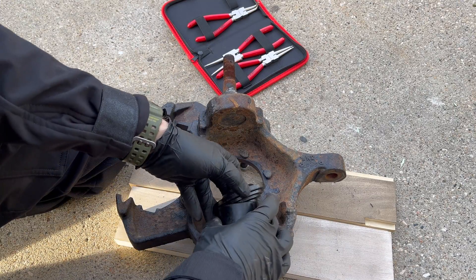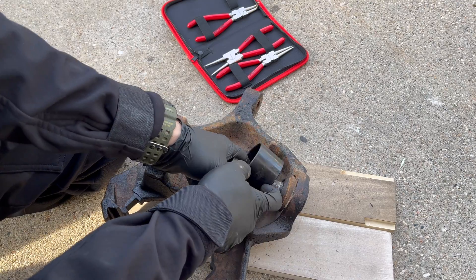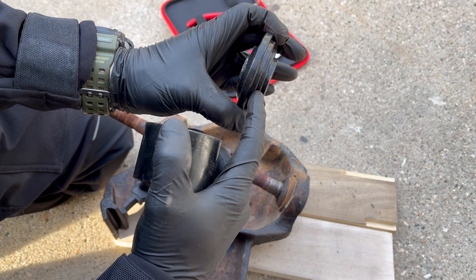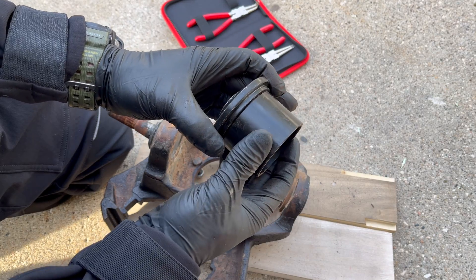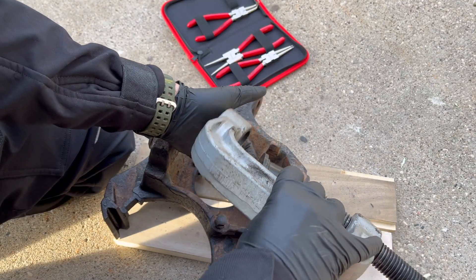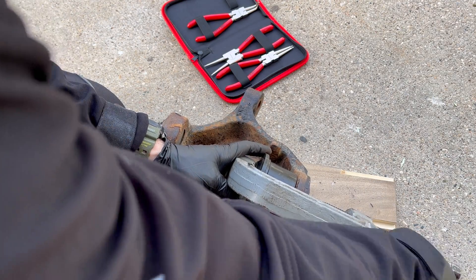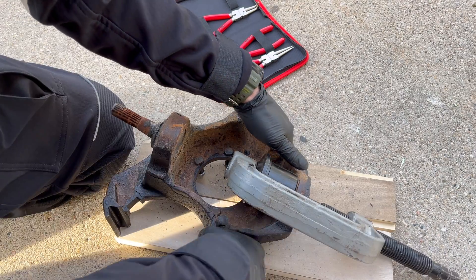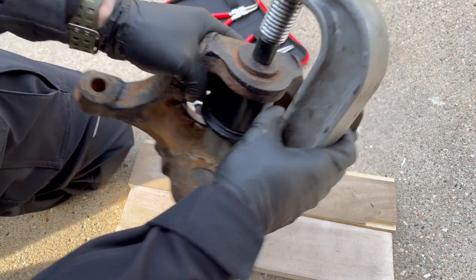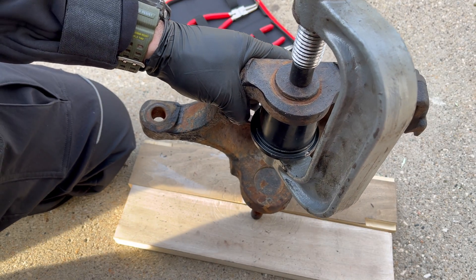I have my ball joint press — don't try to do this without one. There are ways, but it's worth renting a press to make it easier. I've got this sleeve which fits around that, and then there's this hat with a kind of stair-stepping or wedding cake design. Put that there, hole out the back, set it up. Take the press with the hole at the top, giving room for the ball joint to travel upward, then tighten force at the bottom. On the top you can use a wrench — I actually ended up using an impact gun even though the box says don't, because it makes things go a lot faster.